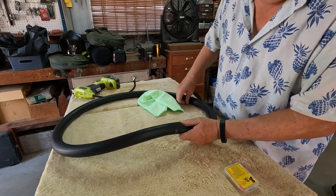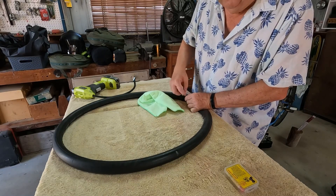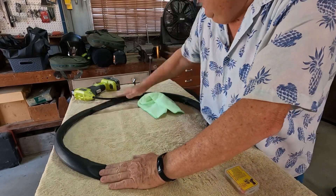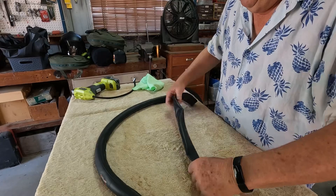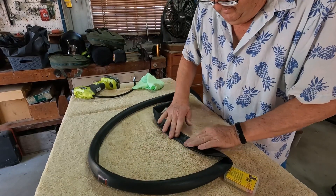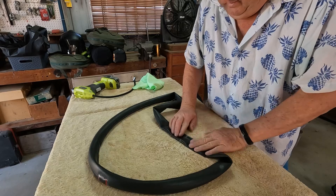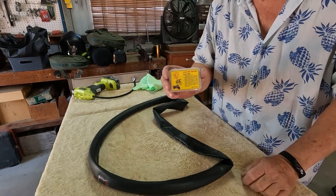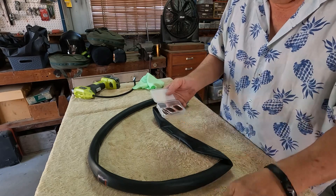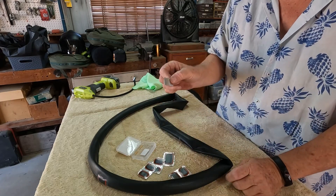Now we'll let the air back out of the tyre. I like to take the valve out with this part of the job as well, just so no air gets in under that patch, then we can flatten it down. I know that the hole is in between the two lines. What we need to do now is roughen up this surface. I've got a small puncture repair kit — just a cheap one. It has a rubber solution glue, a few patches, and the bit we need to rough it up with.